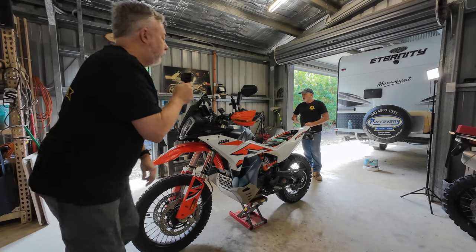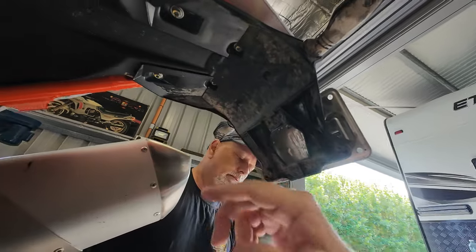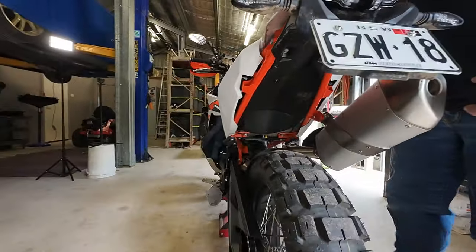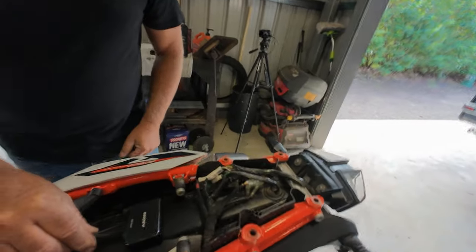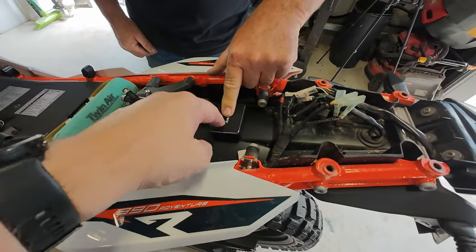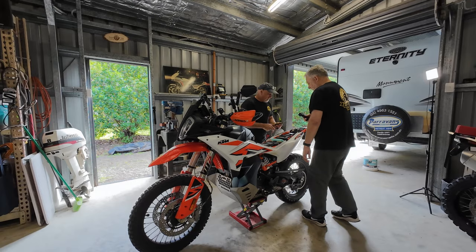For the rear one, I don't want to put it on the rack. If you look underneath here, there's a bit of room, and I was thinking if we undo these bolts and mount the rear one like that, it'll be out of the way of the light but won't inhibit anything. We'll take this lever panel off and run it in with the other wiring. This is the brains of the thing — it'll sit in here. As we did with the Garmin install, we've got grommets in there for the cabling. KTM's done pretty well getting things ready. There's 3M tape that will go on there, and we might have to just cable tie it up around here.